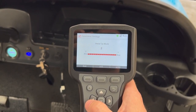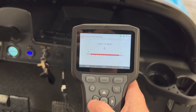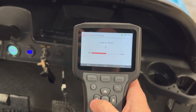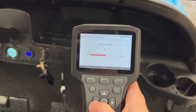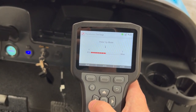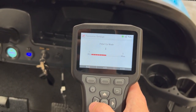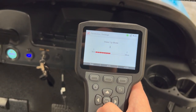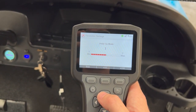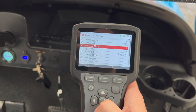An example of where you might want to adjust the regenerative brake setting: if you've just converted to lithium batteries, you might want to reduce this value given that the vehicle is now a bit lighter, and also it's going to generate a little bit less energy back into the battery, which could potentially be a problem for over-voltage in lithium batteries. If you're on a hilly golf course and your regenerative braking is turned off, you might want to increase the value to a higher setting so that you've got a bit more control when descending a hill.